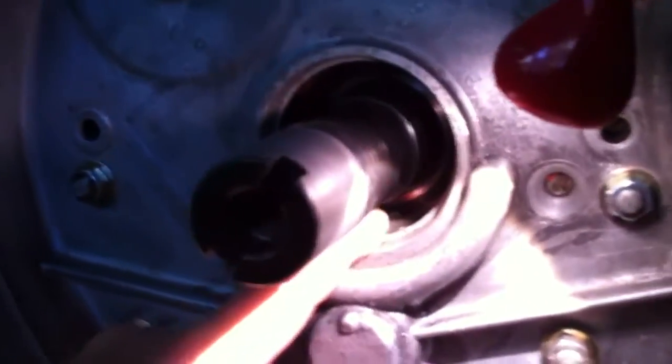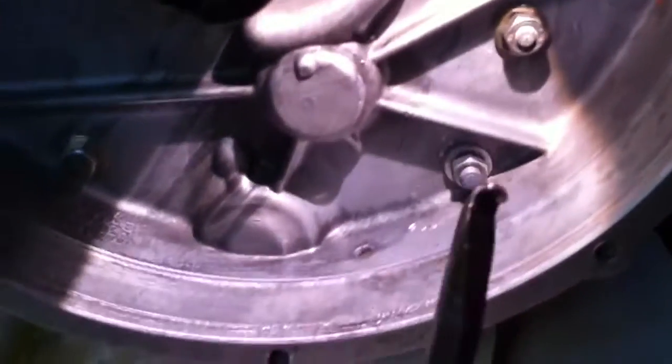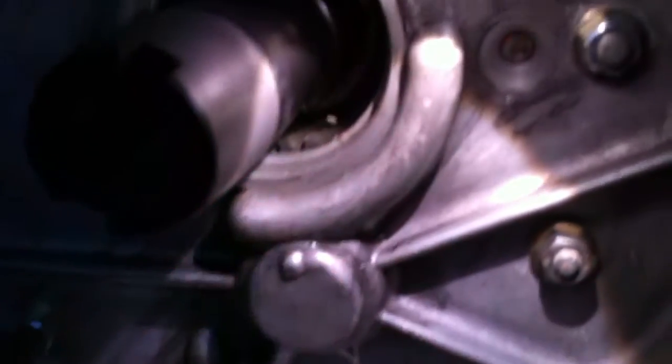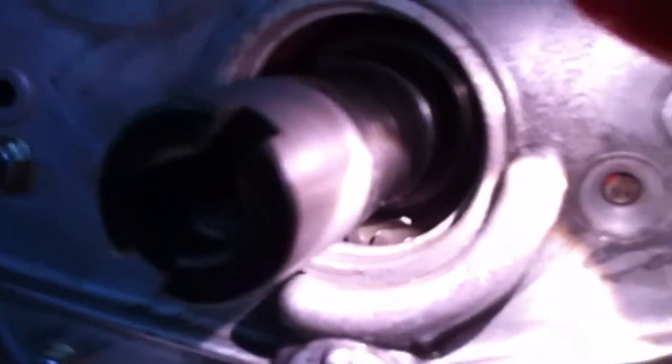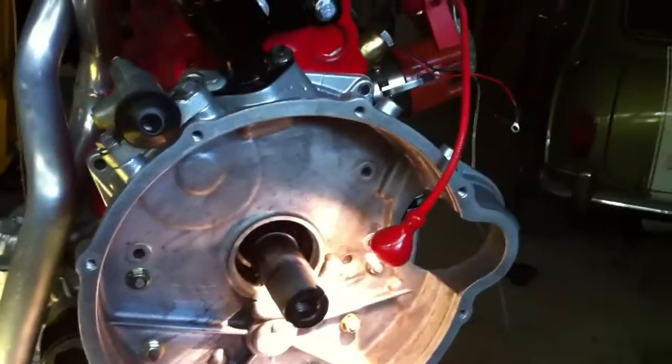With it open, we'll show that you can reach in here with a variety of little tools — a basic screwdriver to push it, or a little hook to act as a puller — to get something behind the gear. We have the ability to give it a little push-pull arrangement. While we can't stick a feeler gauge down there very easily, we can certainly get a feeling. We've seen enough of these that we should be able to tell about a five-thousandths clearance that we can count on not to do any destruction when this does run. Alternate way of looking at your idler end float, from Cooper Road Mini.